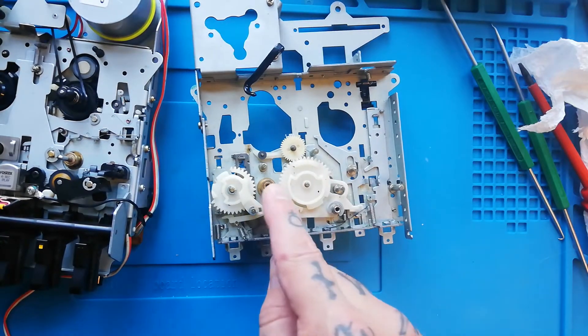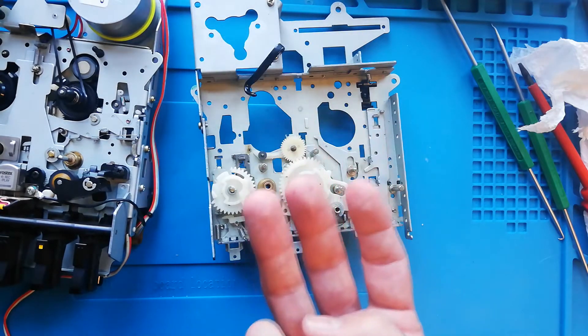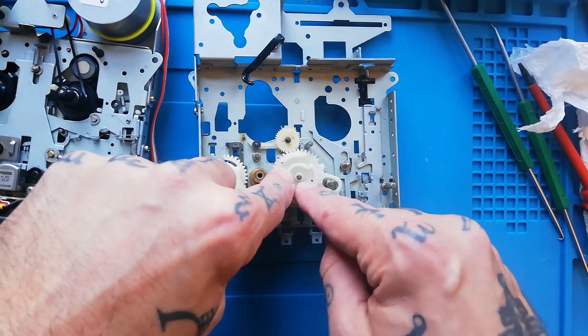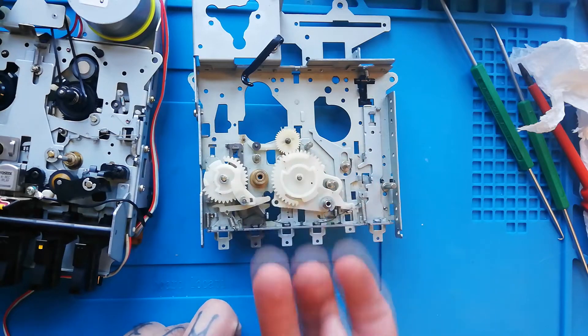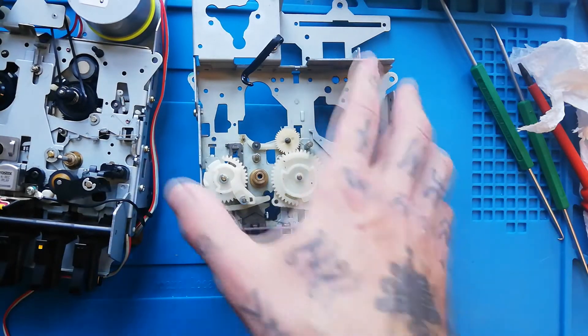A group of plastic parts to the right of this brass slot pertains to raising and lowering the magnetic heads. These posts onto which the parts are mounted are quite susceptible to the grease becoming gluey, so you need to clean that off. Put on fresh lubricant and that can allow the travel of the magnetic heads and the pinch rollers to work properly. Check that you've done that first.